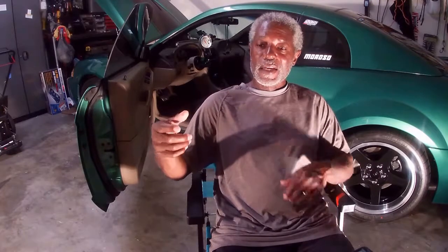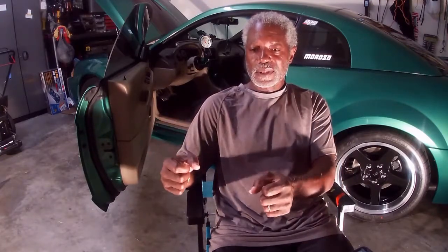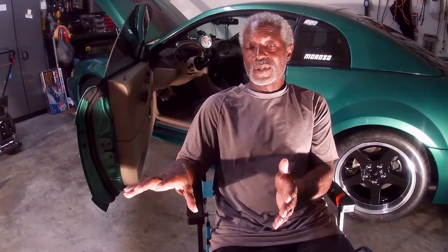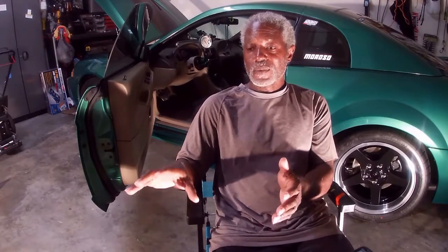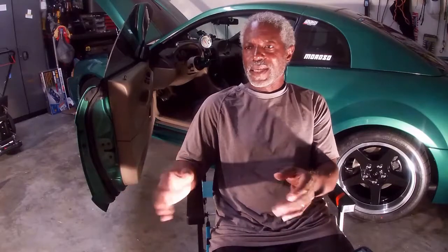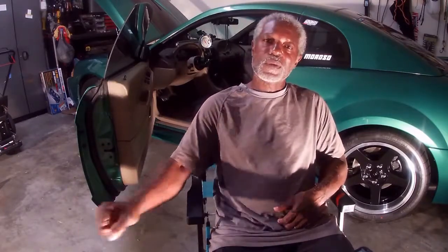and I carefully lowered it and pulled out the shocks, and the coil springs that are in there, like I said, those are lowering springs. So when I lowered the jack, the coils just rolled over. There was no pulling and popping, no having to worry about all that pressure. It came right out, and I lowered the whole thing down as a unit and pulled it right out of the way.